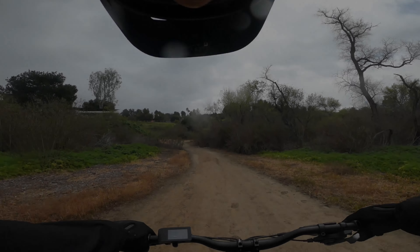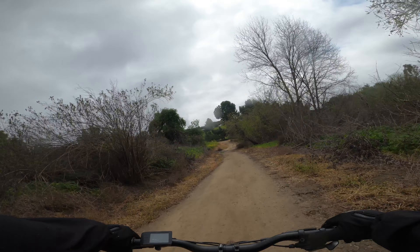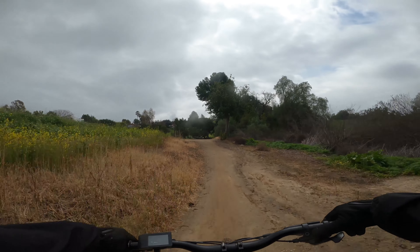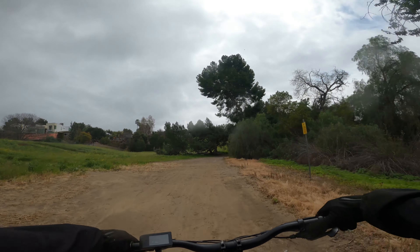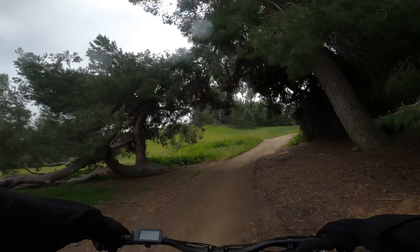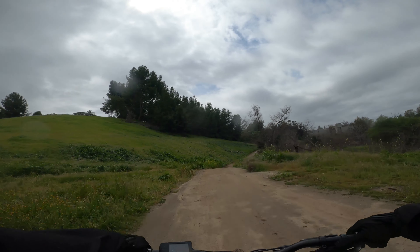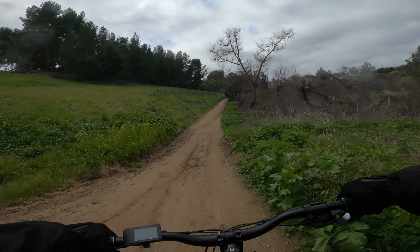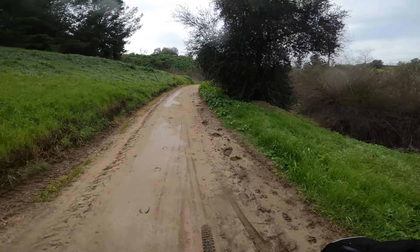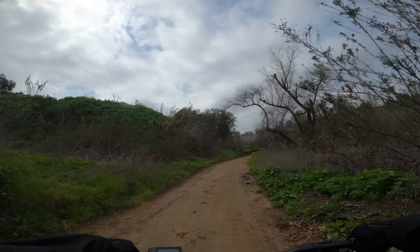The 550s are a little too soft. I'm thinking maybe 600 or 650 would be good. I do have it wound up about three full turns, which is normally the maximum you want to do on coil shocks. It all has to do with stroke — basically the more preload you have, the less stroke you have. And then you run the risk of binding up the coil, which is basically like bottoming it out, and that's not good either.